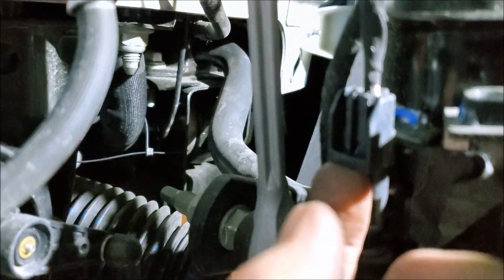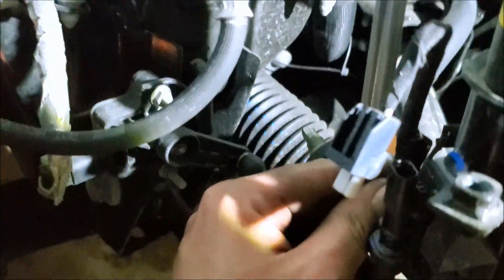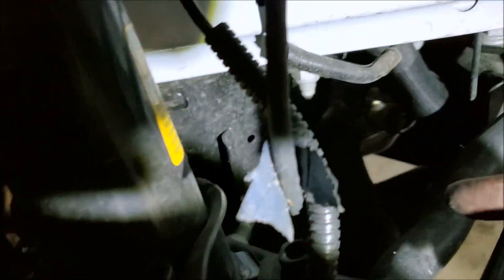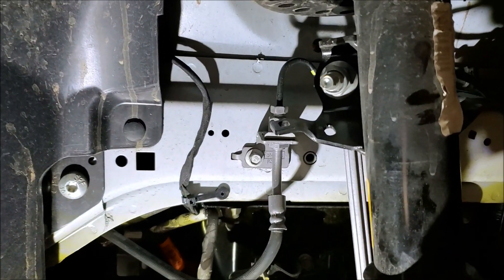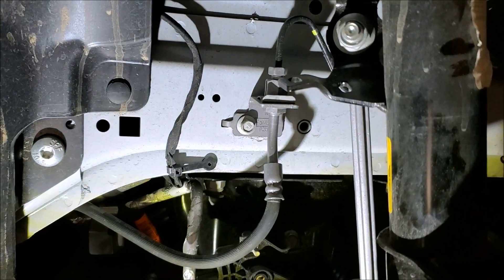With the caliper and rotor off, you need to get all the little wire clips undone. The main one is your MagneRide sensor — there's a little tab underneath, just lift it with your finger and it unclips. There are also a couple of clips on the back of the strut housing and a few more around the side. Don't forget to unplug the MagneRide sensor connector itself, because if you pull the strut without disconnecting it you'll rip out the sensor.